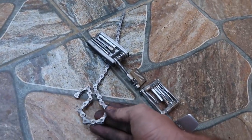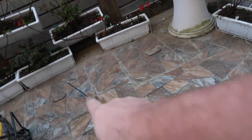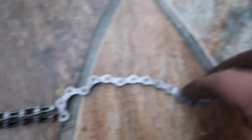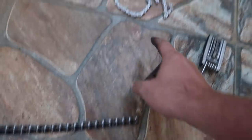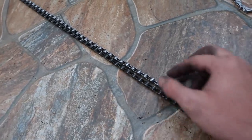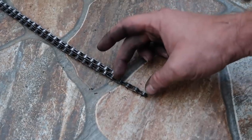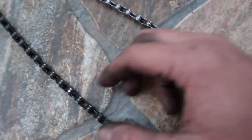This is a big one — the new chain from HP Velotechnik for the trike. I put it alongside the old chain, matched up the ends, stretched them out link by link, and popped off the remaining chain. I'll take a few spare links on the road, or maybe just the whole thing in a bag. Let's see how much the old chain stretched — I pulled them both out and it stretched out three links, so it definitely needed to be changed.